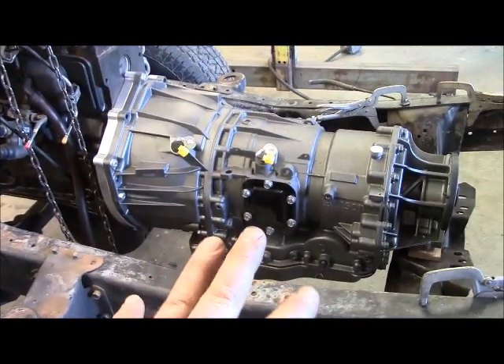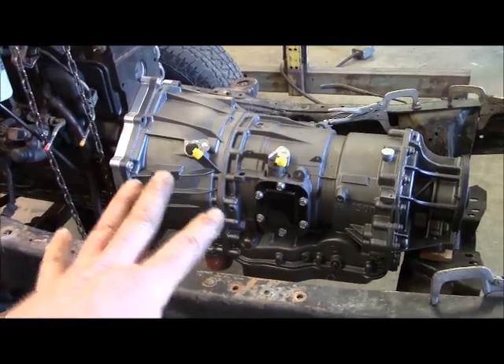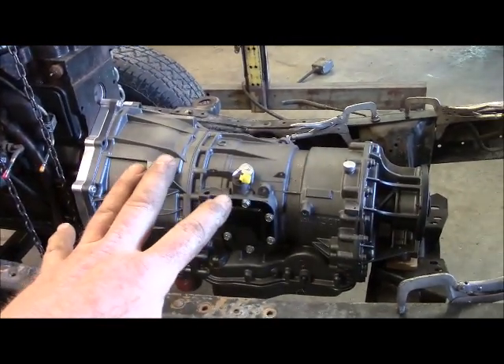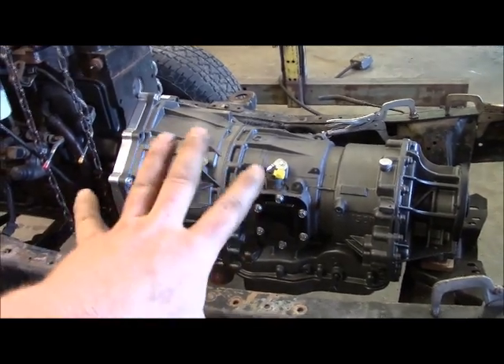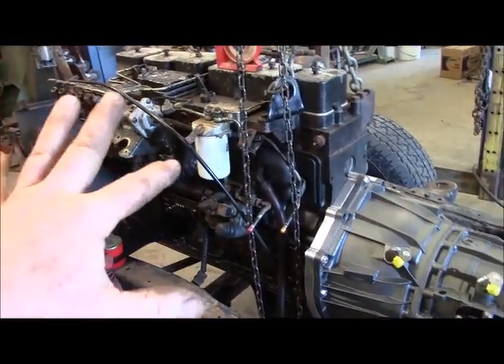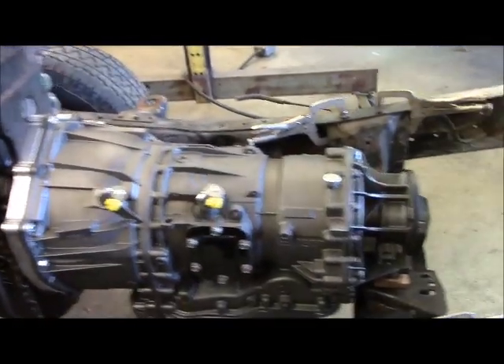Back here there's a little gray area because we're using the Allison 1000 transmission — some people use the 5R110, it just depends on what you want. But if you put the Allison in, you're good for up to a thousand horsepower and you're done. You might as well go ahead and put this one in, because that motor has every trick in the book to make a huge amount of torque, so we'll need to already be set up for that.